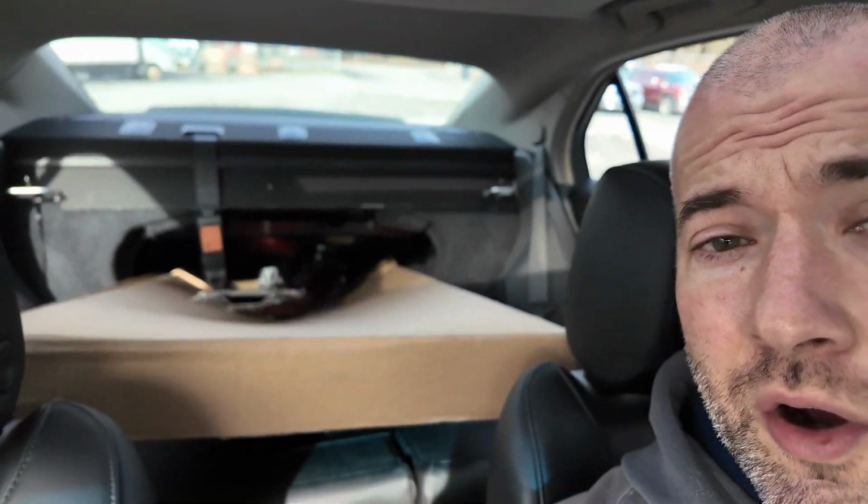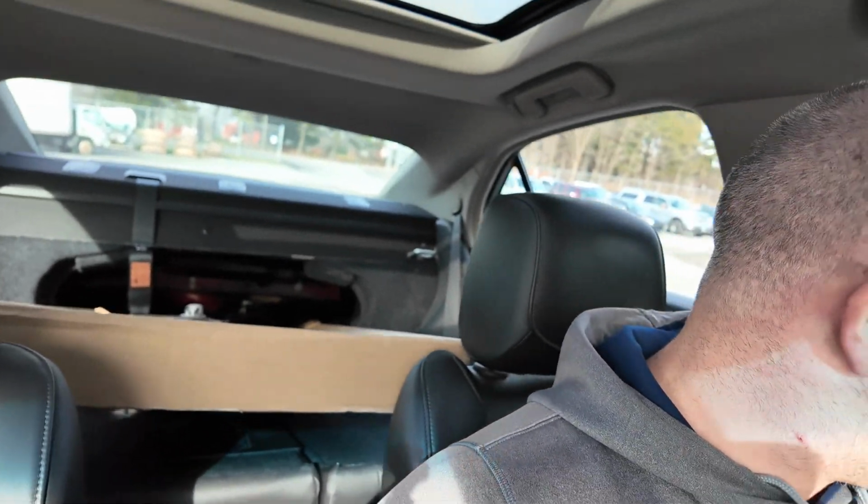I brought a Sawzall because I knew they were going to cut a huge section, and they did cut a huge section. So I had them cut a big old chunk off of it that I don't need. And my Sawzall just didn't do it, boys. Dude, these Subarus are built. Them rockers, there's some sections of it where it's 4 layers of steel, and it's thick steel. Yeah, it chewed my Sawzall blade right up. It wouldn't get through the pinch weld.